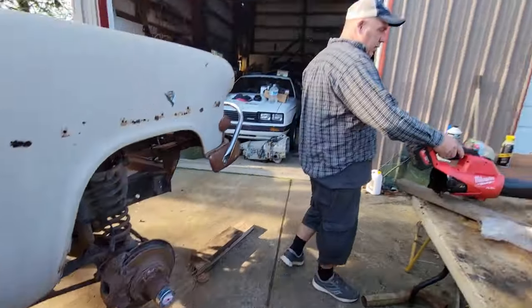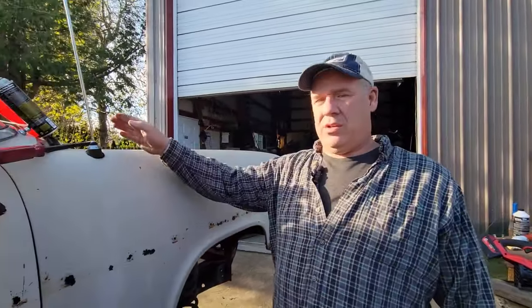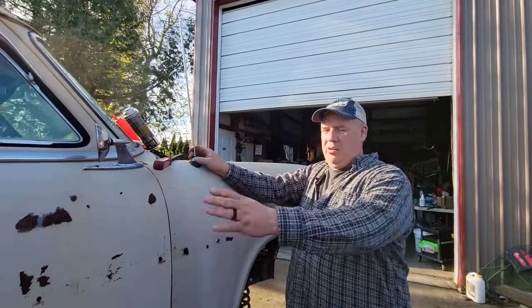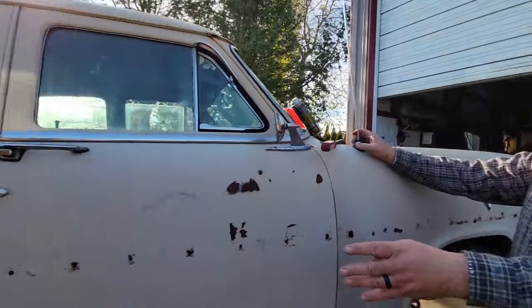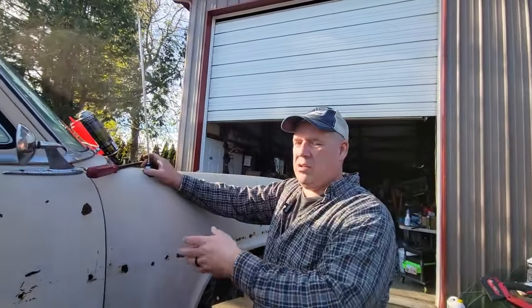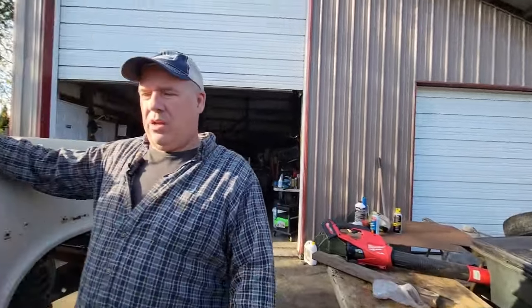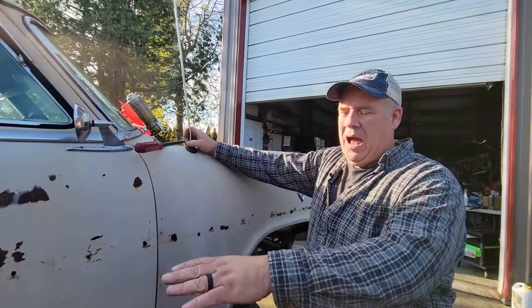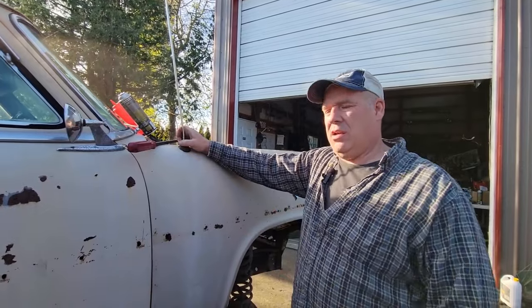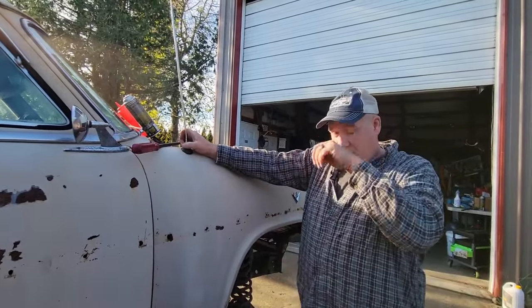All right. So when you bleed the brakes, you make sure you have fluid. You have a person inside who pushes the pedal down. That holds pressure. You open the furthest one first, so we'll start here. If we get air, then we get fluid. It's okay to get the old fluid out. We'll probably go through the whole bottle we bought yesterday. Get that cleared out so you get good fluid. Then you close it. And you may not get pressure till you go to all of the wheels. And it may take several times.